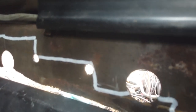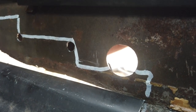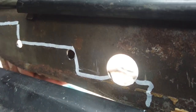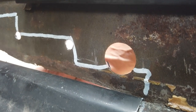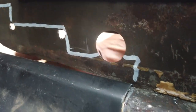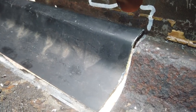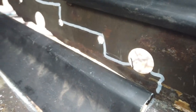I've drilled little holes because I'm going to jigsaw this - the reason I'm going to jigsaw it is it gives me an exact template. If you angle-grind it you don't get as good a template, and I'd like the piece going in to be a nice fit straight in. This is the inner sill - it comes down and below the car and sandwiches between the outer lip of the sill and this face of this floor panel repair piece. That's how that all works.